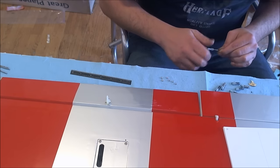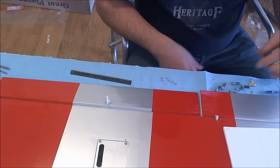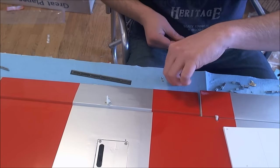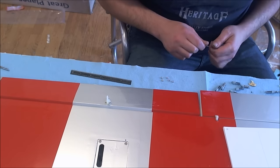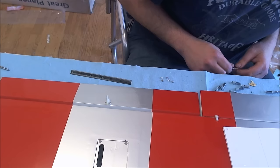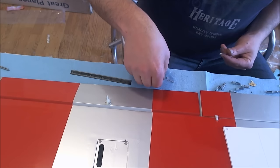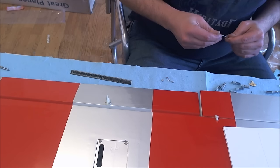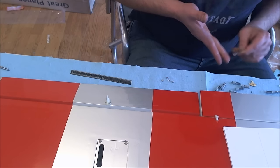And the reason I'm going to go ahead and just get all of them done now is so that when I need a 3 3/4 push rod, it's already done. Now there are specific lengths that we're going to have to set. I think it's 4 11/16 from end to end. Which, if we did everything right, should put us pretty close to trim.